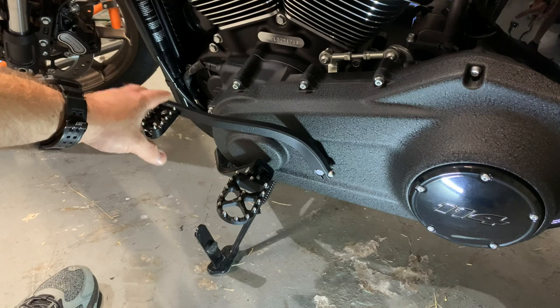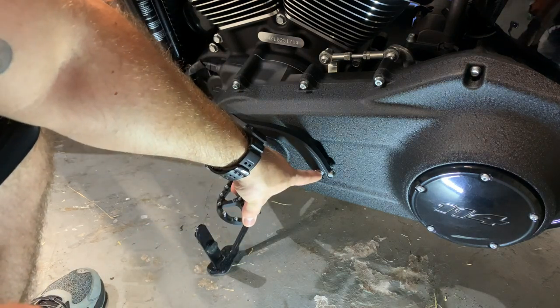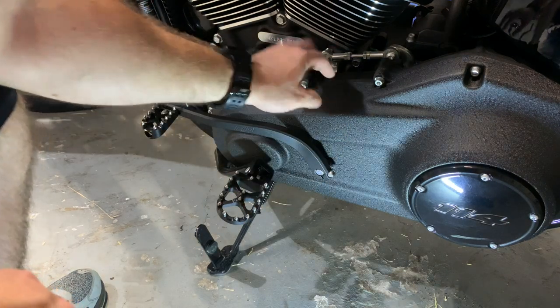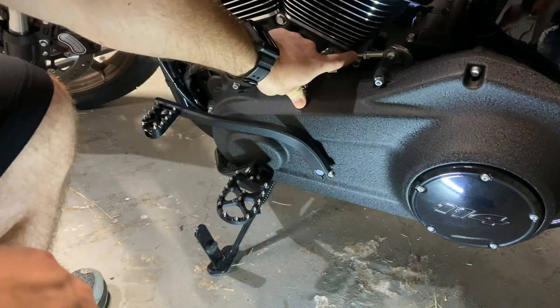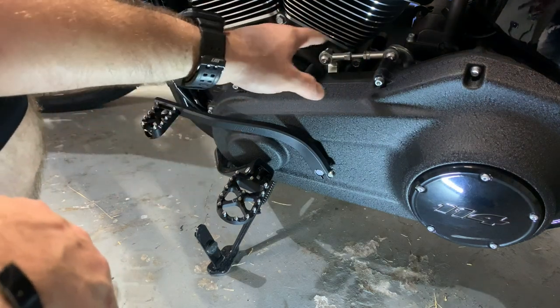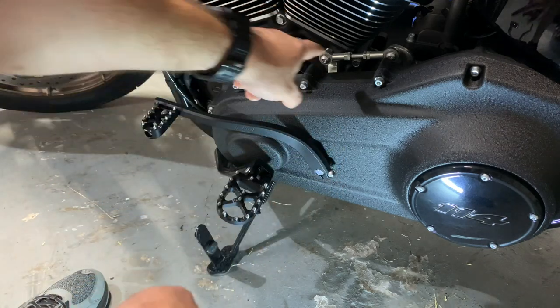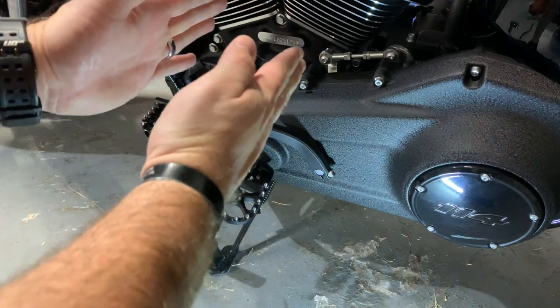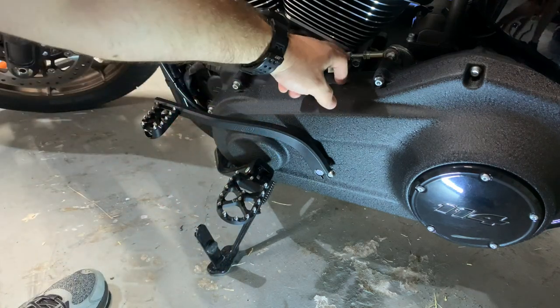Beyond the fact that all shift arms are adjustable right where they connect to your actual shift linkage, up here you see this little linkage in between that has two bolts that can be screwed in or out on either of those pieces. So you have your large adjustability and then your fine adjustability to incrementally move it up and down. That is just one thing to note.